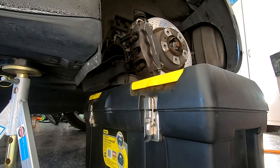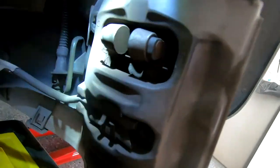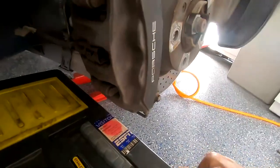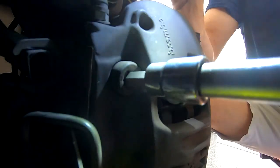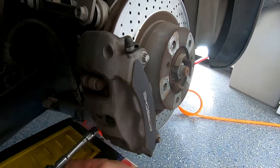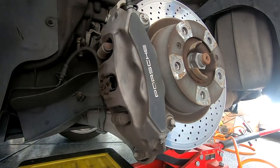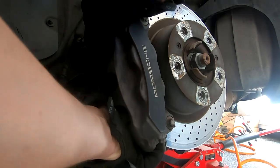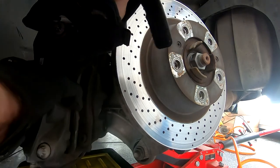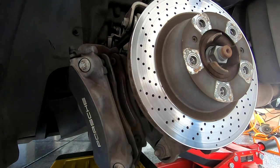I'm going to use my toolbox to rest the caliper on when I take it off the rotor. There are still lines connected, so I want to be careful I don't overextend them. To take this caliper off, there are just two bolts — here's one and here's the other. These are not that tight; they're supposed to be torqued to 63 foot-pounds. Porsche recommends replacing these bolts every time the caliper is removed, especially when replacing pads and rotors. When you take the bolts off, the pads are still gripped onto the caliper — the easiest way is to pull from the bottom and it slides right off. The brake pads are exposed and we need to open them up for the new pads, since the new pads are thicker and need room to fit back on the rotor.